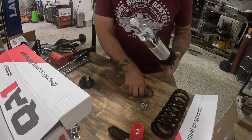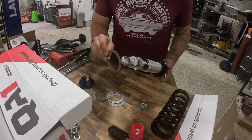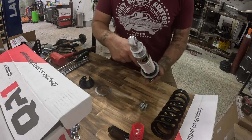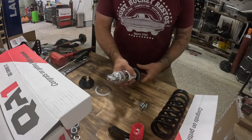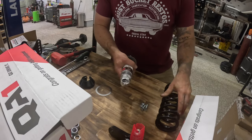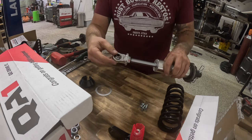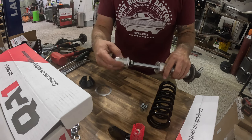Okay, and then the kit comes with a few different washers and then also needle bearings. And so the sequence, washer, needle bearing, and you're gonna wanna anti-seize both sides of the bearing as well. Washer on top of that. Then the coil spring goes on top of, actually, two things. Real quick, we're gonna wanna extend the cylinder here, or the piston end of this. And then I also went ahead, I already cracked this loose. So we'll go ahead and we'll take that off as well.